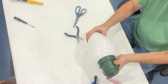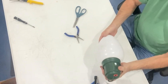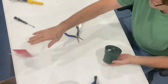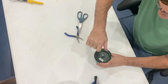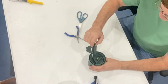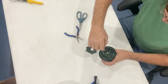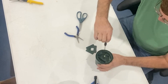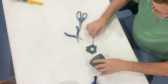Now we're going to get through dismantling the bulb. We don't need all the insides and we don't need the label, so just follow me and see how this thing comes apart. Unscrew the globe, take it off, set it aside. Take off the label — it's not needed. Inside the mechanism there is one screw for the battery box, so take that out. Take the batteries out — they just snap out. And there are three screws holding the mechanism in, so these three screws you need to keep. Just stick them right out. You're going to be able to pull the mechanism right out of the housing. Save these screws because you're going to need them later when you want to put this thing back together. Set them aside and keep them in a safe place.